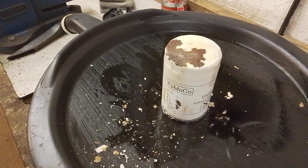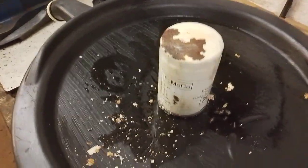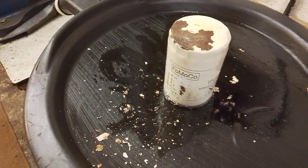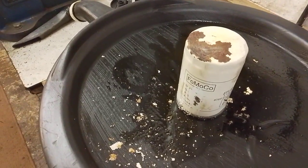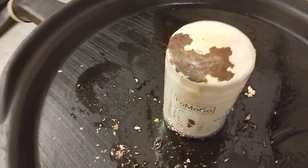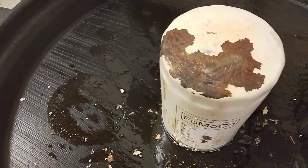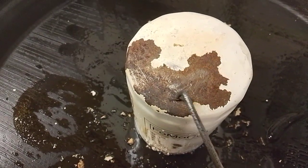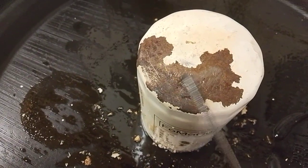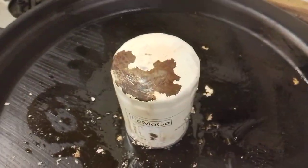I know they're probably made from recycled steel and made as cheap as possible, being a disposable item. It's not something you expect to last in your car for many, many years, but you would hope that after a year of service, particularly in favourable conditions, it hadn't started to corrode away to the point where it could give up. I'm just trying to show on camera how deep the corrosion is, and there's quite a sizable dent formed in there. I've just been pushing on it.